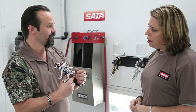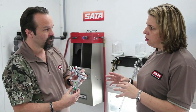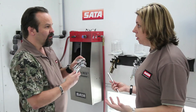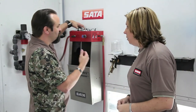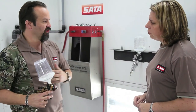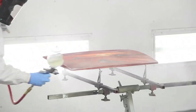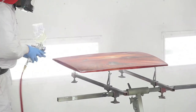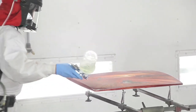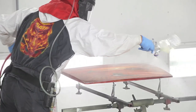It's really important to keep the micrometer as close to open as possible. In addition to paint problems with bad lays of base and clear, it can also cause material usage issues. If I'm overriding the horns, I may be using too much or too little product, affecting profitability. If I'm using too much air and it's over-drying the base coat, it's going to lay down coarse with texture. On clear coats, too much pressure over-dries it, causing people to slow down and flood more clear — way over-using material.